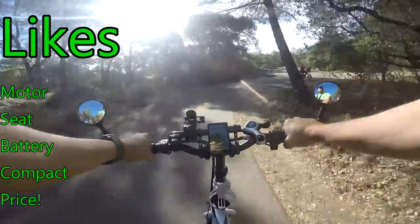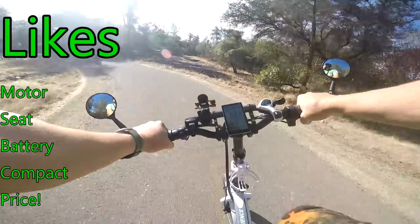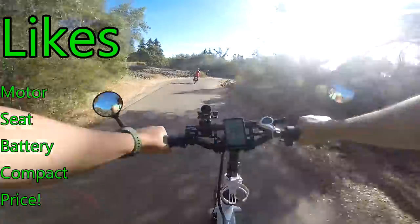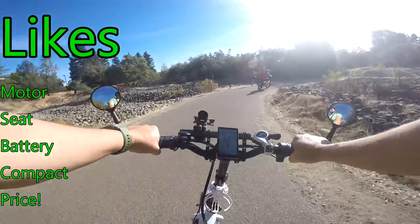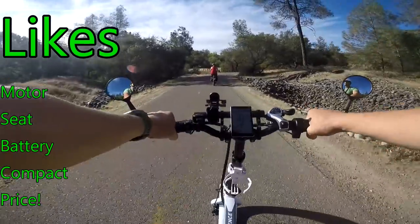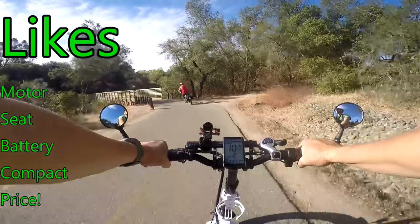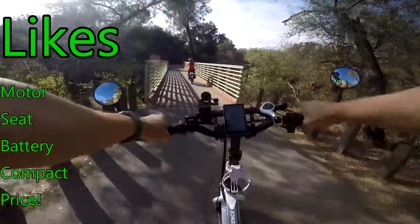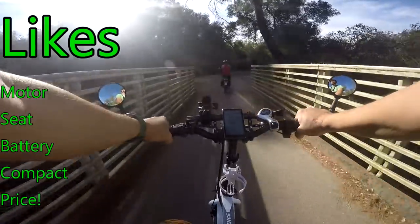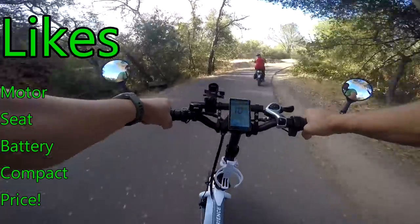The fat tires do supply good shock absorption, especially if you air them down a little bit. I think I'm running like 25 in the front and 20 in the back, sometimes 25 in the back, just to give it a little bit of extra shock absorption. And they seem to be running fine. I have to still mess with that a little bit. I do like the fact that they have mechanical disc brakes, which are easier to work on and have good stopping power, although they're a little bit noisy.